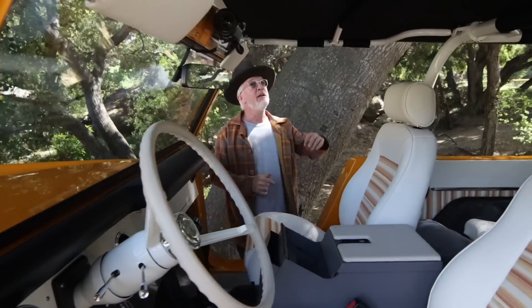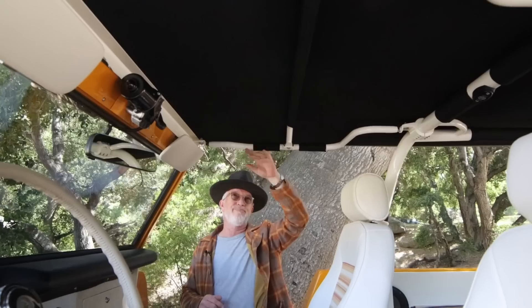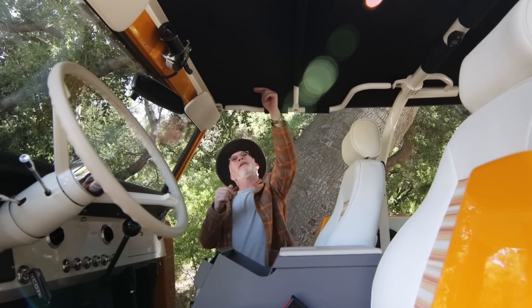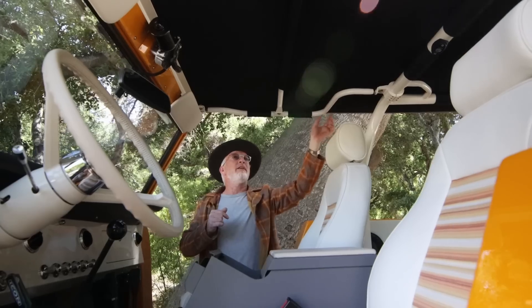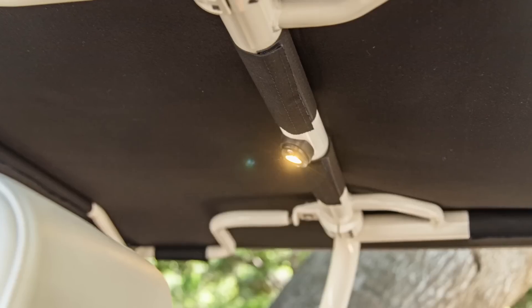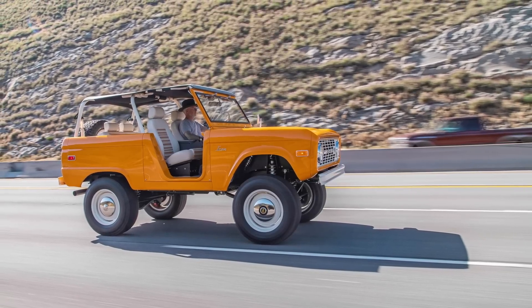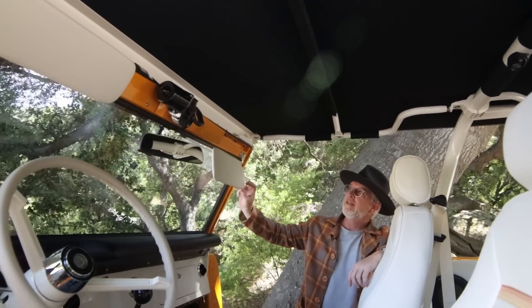Grabber Orange with a nice medium gray for the bikini top. That's the same insulated technique we use on our full soft tops — black on the inside with an eighth-inch waterproof closed-cell foam that gets heat laminated, and then a one-layer canvas for the black finish. The frame is all CNC'd and powder coated, which keeps not just your bikini top from flapping around but also tightens up the notoriously loosey-goosey Ford windshield frames.